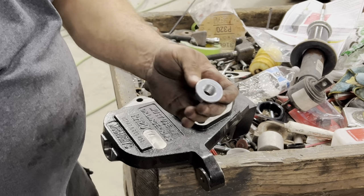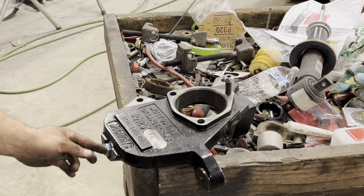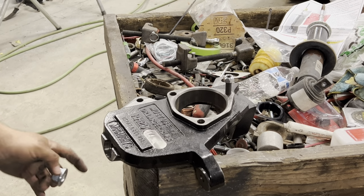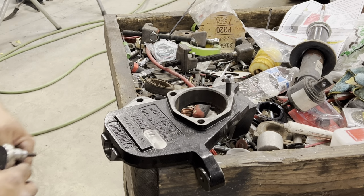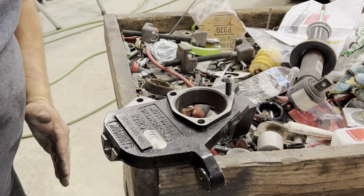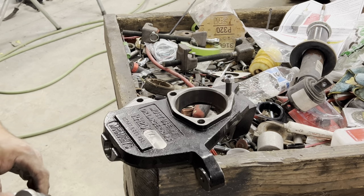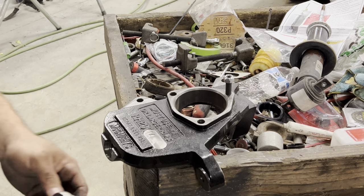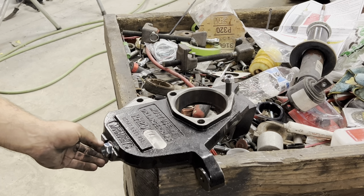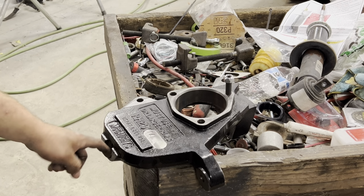And then also it comes with a new lower ball joint nut that goes up into the spindle, so that it'll clear those 17 inch wheels. When the wheel's here and you move it up to here, it moves the bottom of that wheel up from here to here, makes it really tight on the spindle. So that helps with that. If you don't do that, you're probably gonna run into some clearance issues if you got a stock 17 or 18.